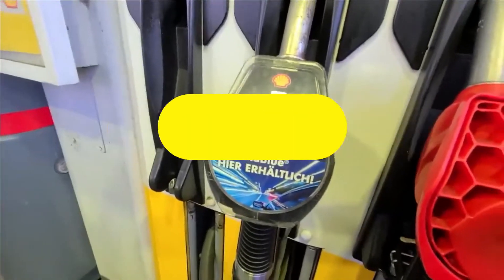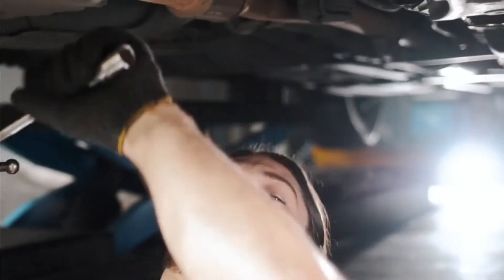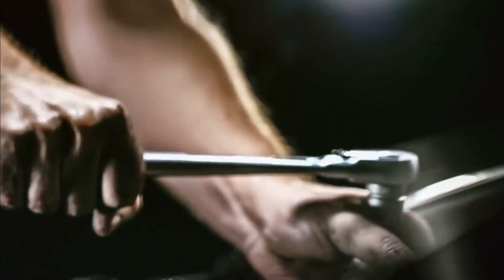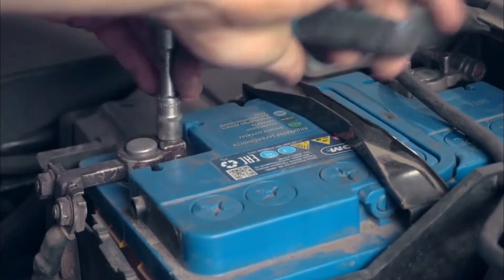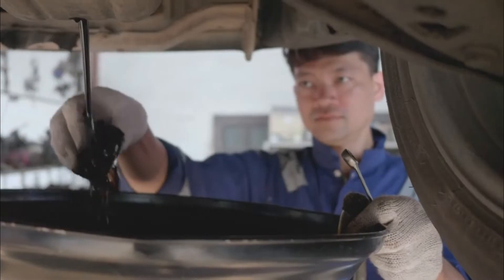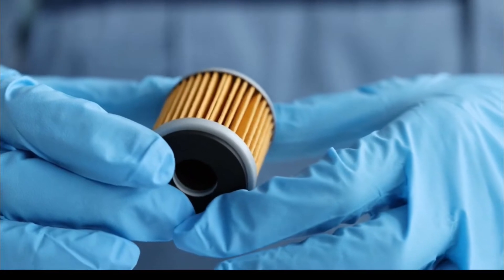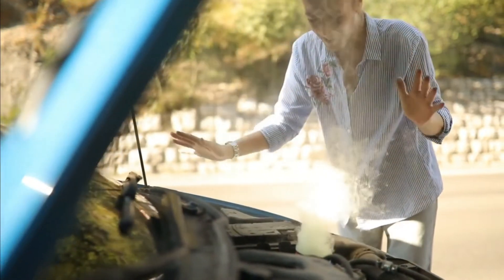Remove AdBlue. It is highly recommended that you contact a fuel technician to safely remove AdBlue from your vehicle's diesel tank to avoid causing further damage. AdBlue mix-ups happen every now and then, and you don't have to panic — it can be resolved. You'll need to have the fuel tank drained out and to flush out the fuel filter and lines. It might cost you a little, but it is far better than damaging your car and having to buy a brand new one.